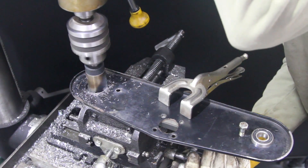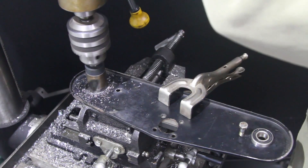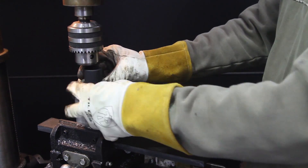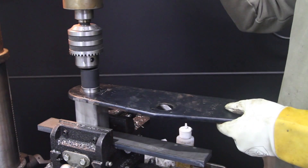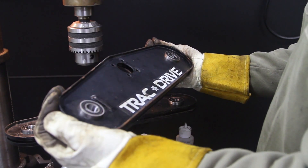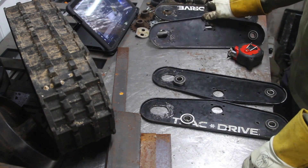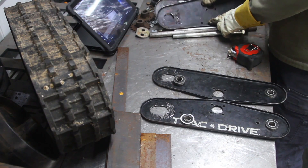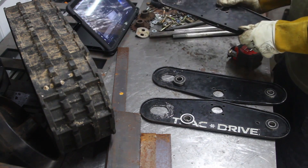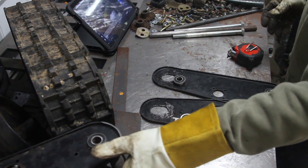Having to oblong the holes is really depressing because it's one of the problems I had on my last robot that I wanted to fix and avoid. I wanted to have nice press-fit bearings in all of the axles, and now I've got the same mess that I had on the other robot.